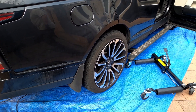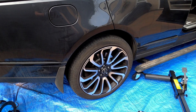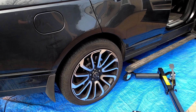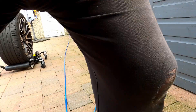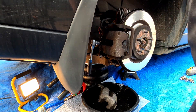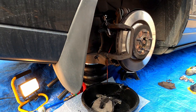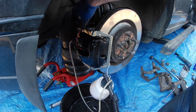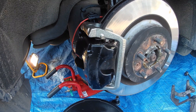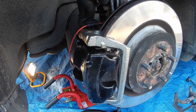So we're now going to do the same with this one - we're going to try and put it in service mode so we can pull the caliper back into position. The other new caliper seemed to be out of sync when we put it on - it wouldn't work properly. But now, after we pulled the caliper and pulled the piston back, it seems to be working fine. Let's get the handbrake tested and we'll see if this one's in sync. So you want to put the ignition on? Ignition on - put the handbrake on. Yep, that worked fine.